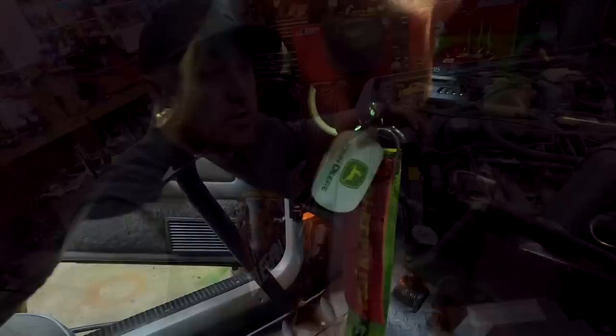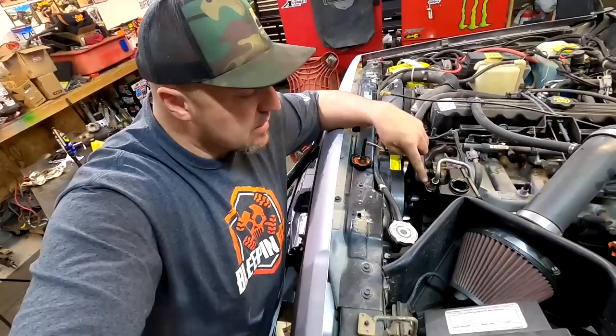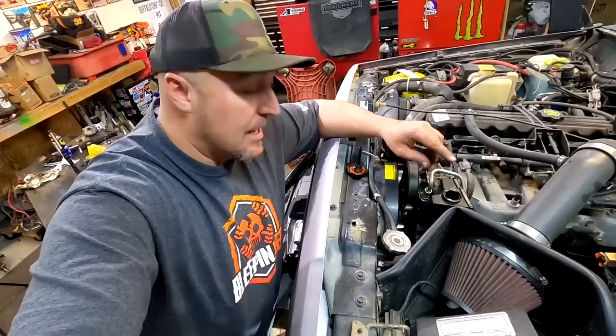I worked it back and forth at least 20-30 times, kept filling the top off to get as much air out as possible. Now I'm going to bump-start the engine just a little to get the pump running briefly, check it again, and keep repeating. After a quick bump start, the fluid dropped from full to halfway in the reservoir — so I filled it back up. It's really ideal to have a second person watch the pump while the other person steers, but today I'm by myself.